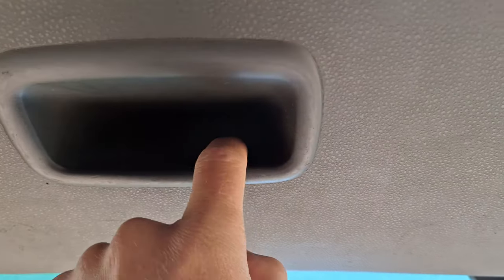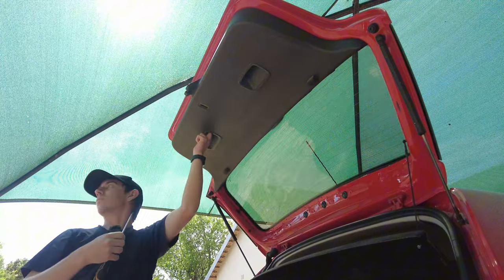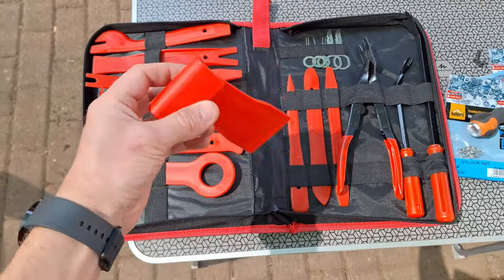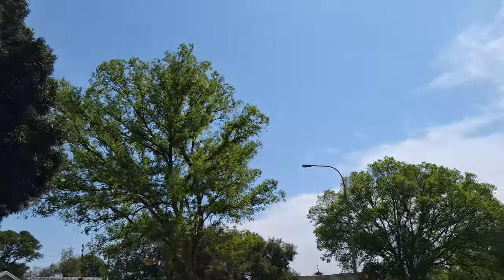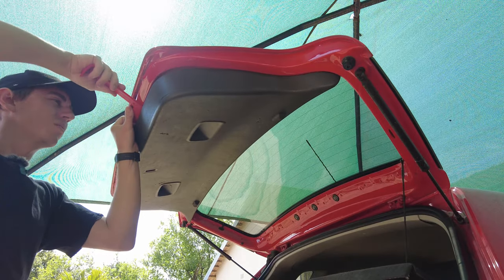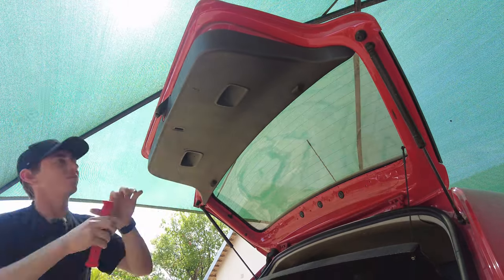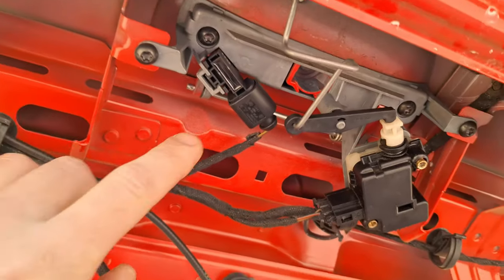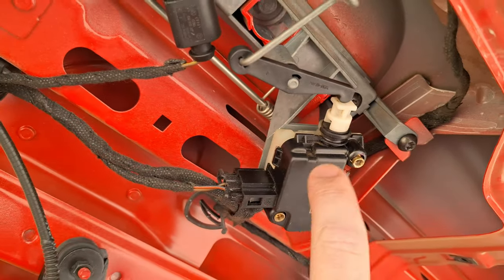To get this off there's a star screw inside there and another one inside there. I bought this body panel clip set off the internet — I'll leave the link in the description below — and I'm going to try these tools out to take the panel off. Sorry for the noise in the background, there seems to be a tracking helicopter flying over our area. There we go, that's off. We can see the micro switch and the actuator that pushes the lever to open the boot.